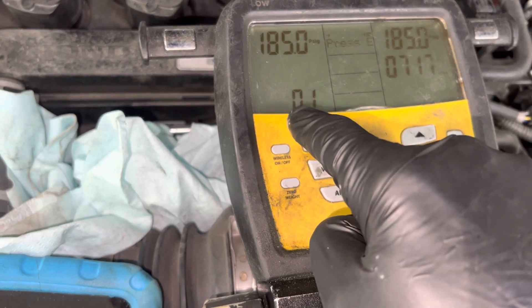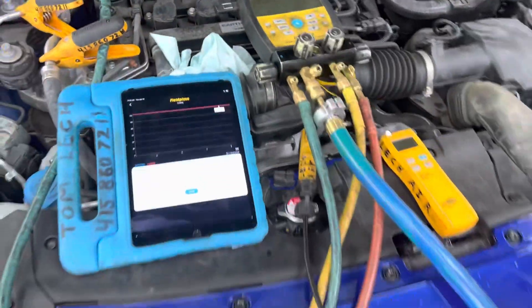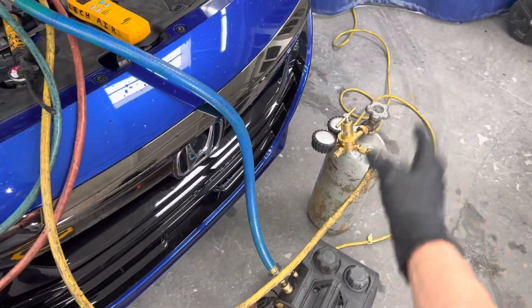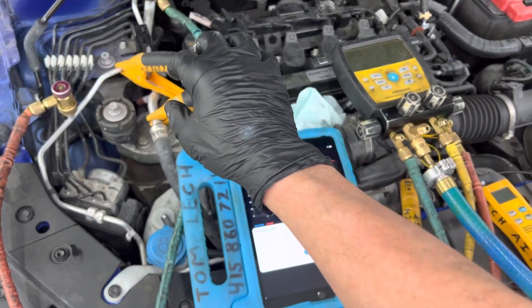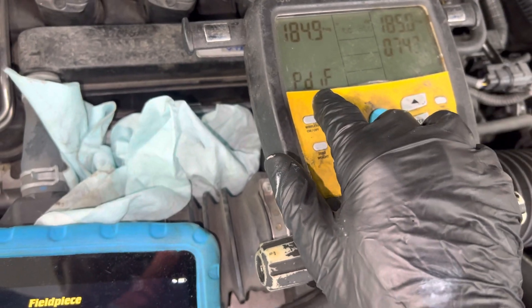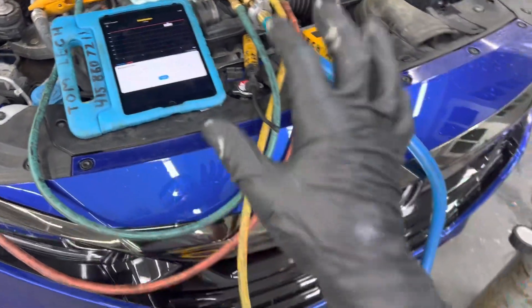It actually says there's a 0.1 — one-tenth of a psi — raise, and the reason is that the temperature of the nitrogen in the bottle is lower than the temperature of the engine and all the metal, because this was a running engine. So everything is a little bit warmer than ambient temperature. As you put your nitrogen into the system and it starts absorbing the heat, the pressure will actually go up a little bit. We actually increased by 0.1 and it's fluctuating, but basically there's no leak under pressure. That was the pressure decay test.